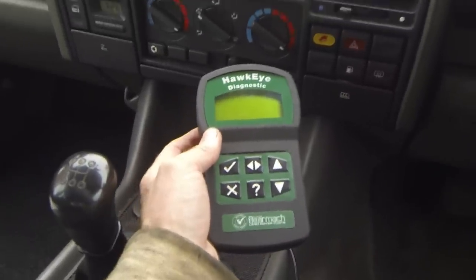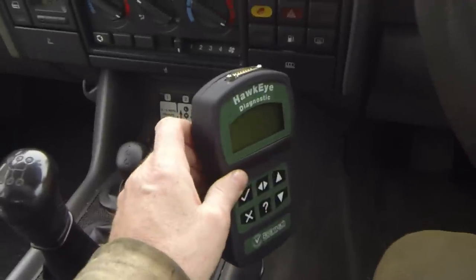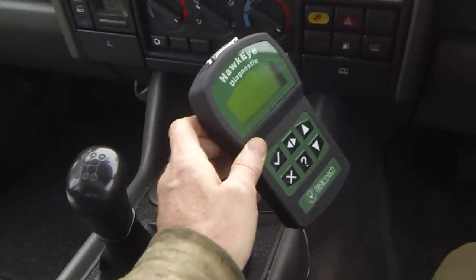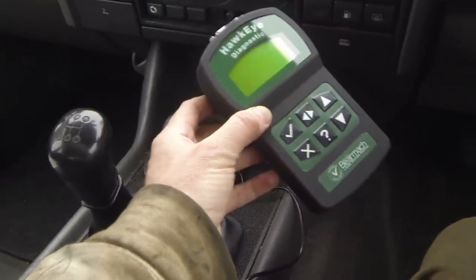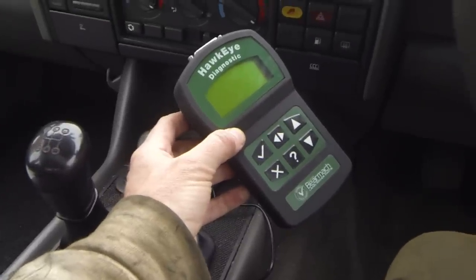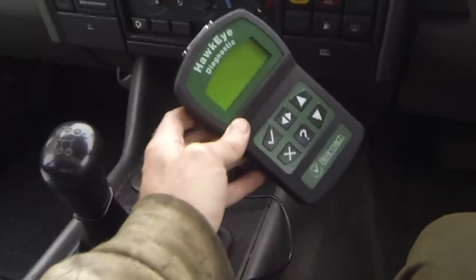Then OBD came along, which stands for onboard diagnostics. Around about 1994, OBD2 came along. One of the good things about OBD2 was that it standardised the socket used — the cable between the tool and the car itself. That's called the DLC, the data link connector — not downloaded content! In the case of the Discovery 2, it's the J1962. They also standardised the protocol for signals going back and forth between the tool and the vehicle. Then the EU came along and around 2000–2001 created the EOBD, which stands for European OBD. I believe it's essentially the same as the OBD2 standard.